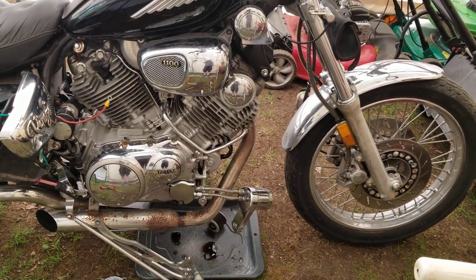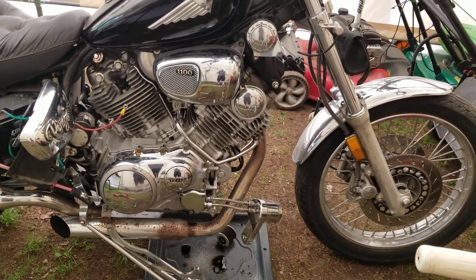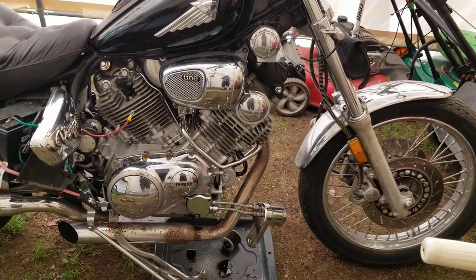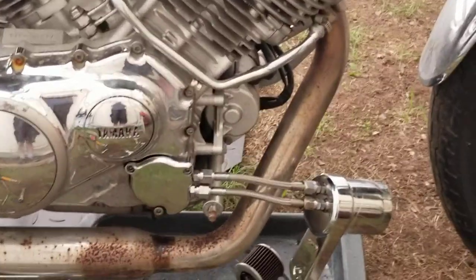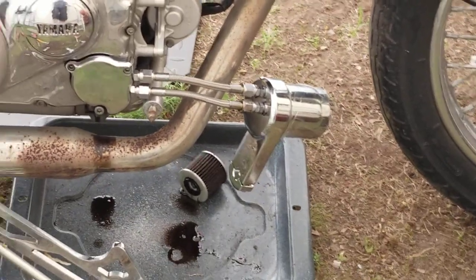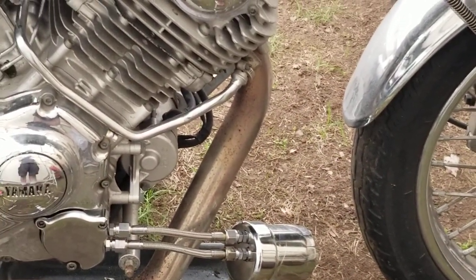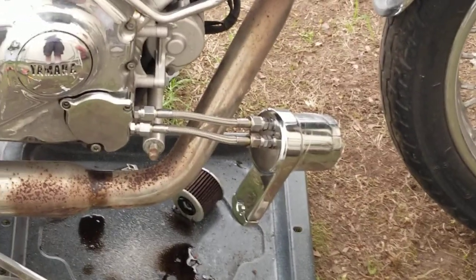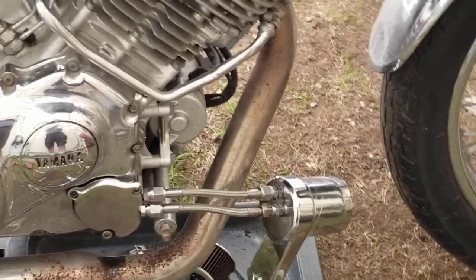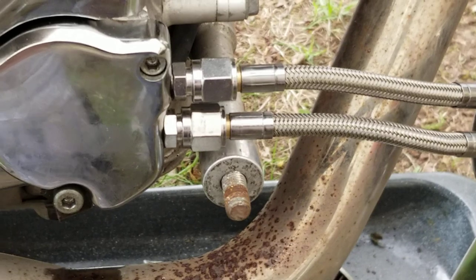Other than that, all the modifications were pretty simple — about 45 minutes of drilling, prep work, cleaning, blowing it out, washing it down. The lines that come with these kits have been called junk by people who've done this modification, and they've been riding a long time, so I'm just going to replace them. The fittings currently come out straight, which means they'd route right around the exhaust — and that's where danger happens. I'll be using angle fittings to bring the lines closer to the starter and away from the heat.